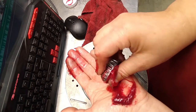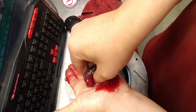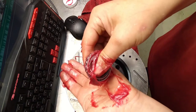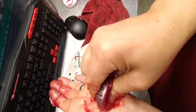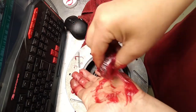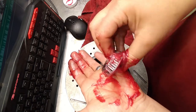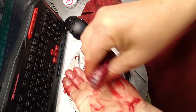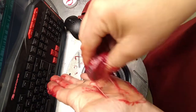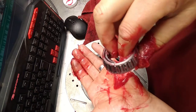That's exactly what you want to do to all of it, 360 degrees. So you just go like this. Yep, came through. Moving on, turning it. Yep, it's coming through. This is sticky grease because it's Lucas. This is really good if you're hot rodding it and hauling ass on the freeway, or on the track. This grease will stay on the bearing. You're never gonna run these dry with no grease and have a premature failure. It's just not gonna happen, not with this kind of grease.